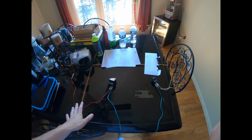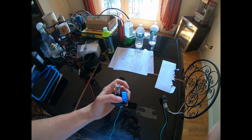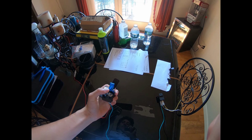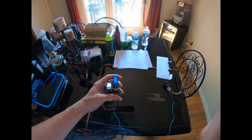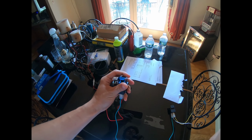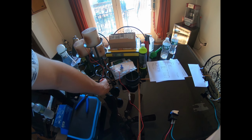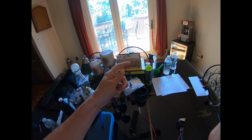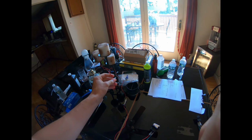Alright guys, so here's the wiring. Let me explain this a little bit. This switch, I already have this all wired in. This is the light bar for the top of the truck. And I just added in this switch here, which is going to be for turning on the reverse lights manually, without having the reverse lights already on. The way this works is this will go to a 12-volt source. Could be a battery, but you can put them into any fuse that has constant current going to it, which I'll show you when we get to that point.